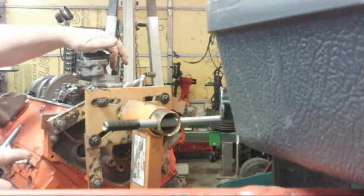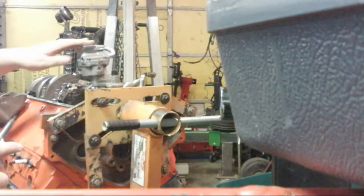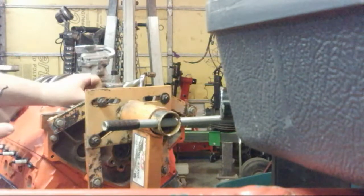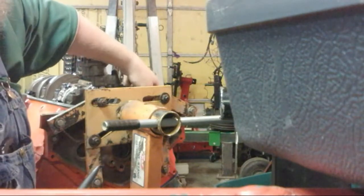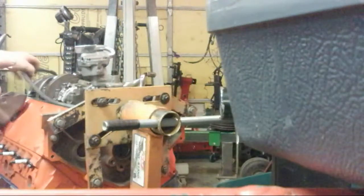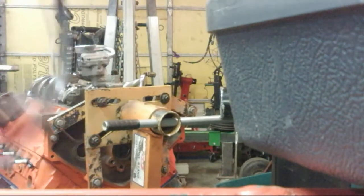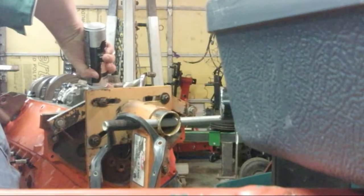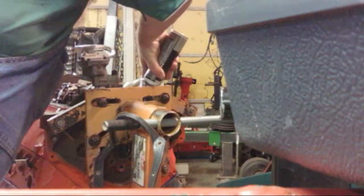I got an oil pump stud in here. It's been torqued. This has been drove on. It's a tight fit. Clears the oil pan. Everything's been retorqued. Now it's time to put the silicone in the corners to help seal this thing up. I don't want you to drop either, because if I break the thing I can't tap it. Okay. Got the one-piece rubber gasket here too. I did not know this was a quick set stuff. I got 1 minute to work with it.